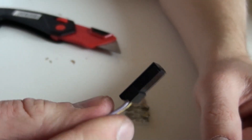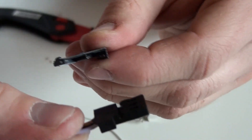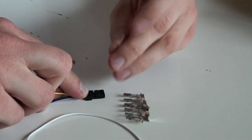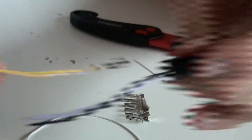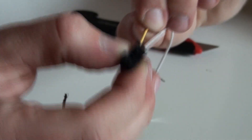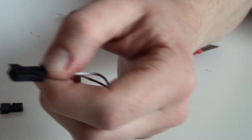The 3-pin one is actually much easier to disassemble because it just slides open, like so. Then we have pretty good access to those tabs, which we just push in. Now the pin goes out of the housing, and then all you have to do is slide it in — it clicks — and click the housing tool to lock it. Then you have your factory pin inside this connector. All of that is reversible: you can reinstall everything when you want to go back to the original, for whatever reason.